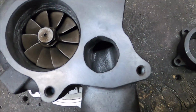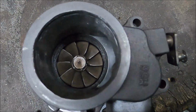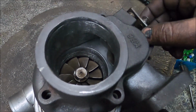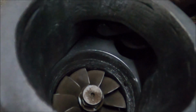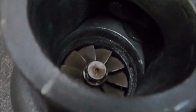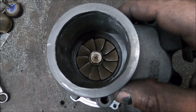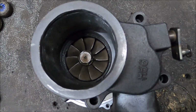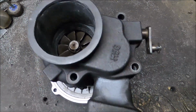Big old wastegate hole now, and unlike before, the outlet part, the turbine elbow, has a very wide opening in comparison to how it was. The wastegate flap and the outlet are now 2.5 inch or more all the way from the turbine wheel, rather than about 2 inch as it was. So yeah, overall pretty chuffed.